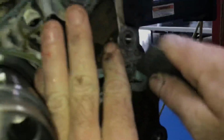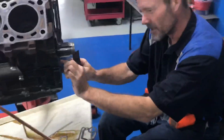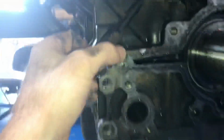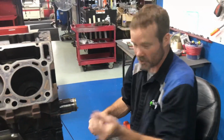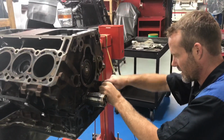But what I have done in the past is just do a couple of cuts on it, just with a putty knife, and then put your finger on it and pull it out. See, now we got this out of the way, and we can fine tune this and try to separate the sealant, because they did have some sealant on here, but see, I'd like to have that little nipple right there. See if it'll focus. That's the bed plate gasket right there. Okay, that little guy. We don't want to pull it out too much, because I've shown on a whole bunch of other ones. They don't take too much care. There's no high tack inside of it to hold the gasket. You will stretch that gasket out, and you will wind up with a bigger leak than what you're going in to fix, say a front cover or something.